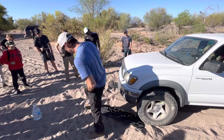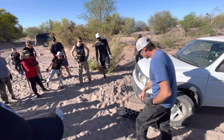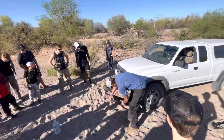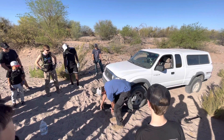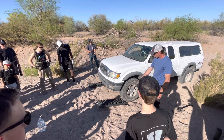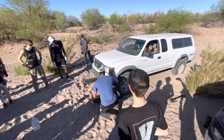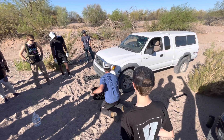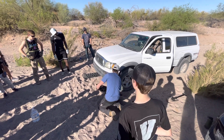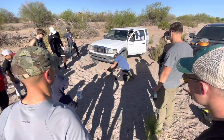If this front end is up, what does that tell me about the other end? It's down and under, right? If you do that, the chances of the tire just going and melting through that traction board is pretty good. So that's why you want to go a little bit further underneath and not just set it there.